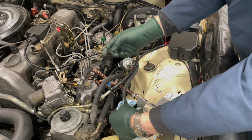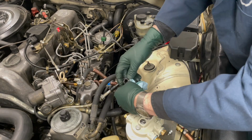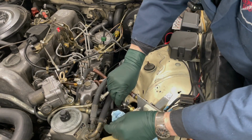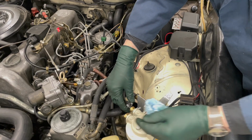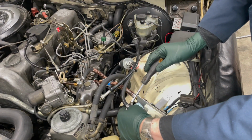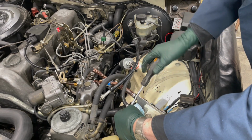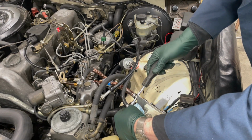Now on these connections to the incoming and outgoing on the fuel filter, I use regular clamps because I may want to take this off for some reason in the future. Okay, and if you have a barb fitting, I'm just going to recommend you don't over clamp it, or you'll never get it off without cutting the hose.